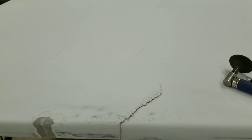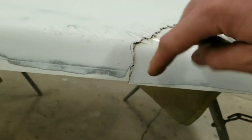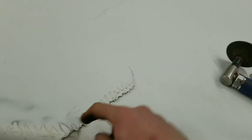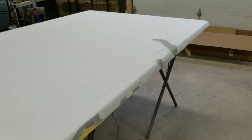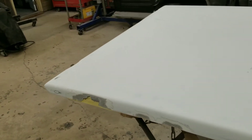There's another one here — I might have to make a relief cut because you can see how this is kind of ripped and there's really no way of lining it up. I'll grind it the best I can, and if I can't get it to lay flat, I'll just make a relief cut. Got it all ground and tapered it out real nice so we can lay a couple good pieces there and have a real nice repair.